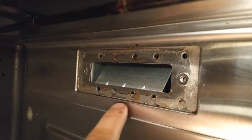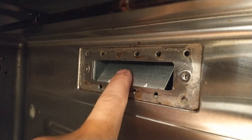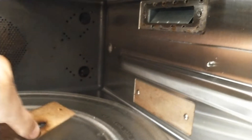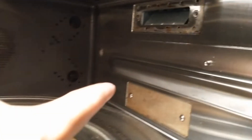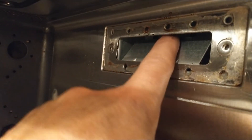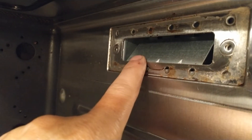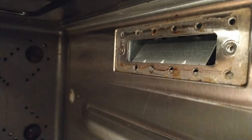This is actually my magnetron — the magnetron is what makes the microwaves that cook all the food in the microwave oven. When this waveguide board starts to go bad, maybe from food particles on it, it starts to catch fire. Basically it stops moisture, steam, and food particles from going back into the microwave and messing up the magnetron and circuit board. You can run it without this board, but it's not advisable because the lifespan of your microwave will soon be shortened.